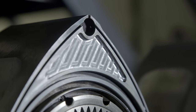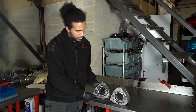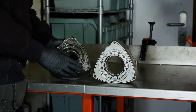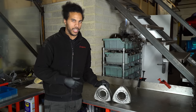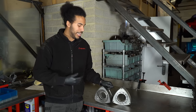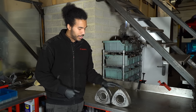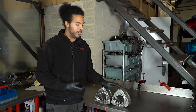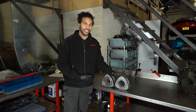Now onto something else cool about big-build rotaries like Dan's: lightened rotating assemblies. This is sent away to a machining shop where material is removed from the faces of the rotor to reduce the rotating mass, which allows the engine to rev much quicker and smoother. You can also take the rev range higher — it'll rev freely to 10,000 rpm without any hesitation. In terms of power gains it's very slight, maybe just a few horsepower, but the drive will be smoother with less load on the rotating assembly. It's like driving on air — it's something you have to experience to know the difference.